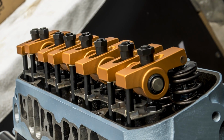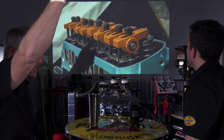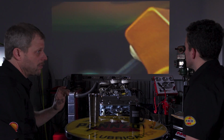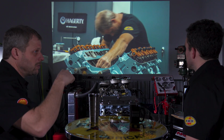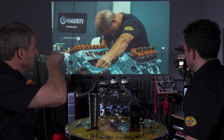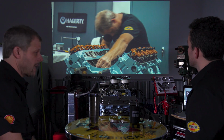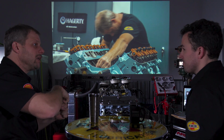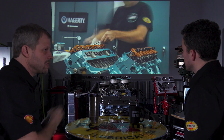Now these nuts, these are your rocker nuts, if you will, and they're actually double threaded. So you have the big hex, which gives you your adjustment function, bringing it up and down, and then the center cap screw is a lock function. It drives to the top of the stud in the head, and that locks it from loosening up or rotating.